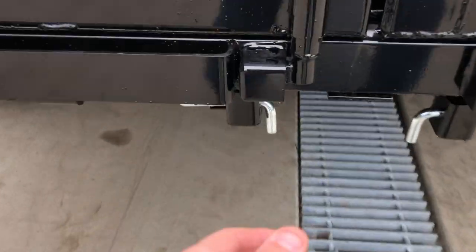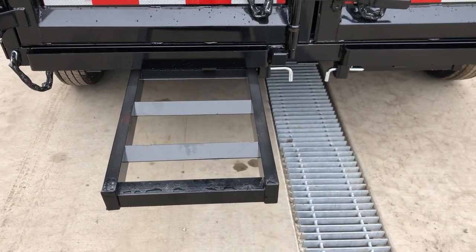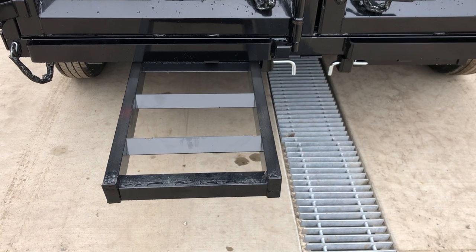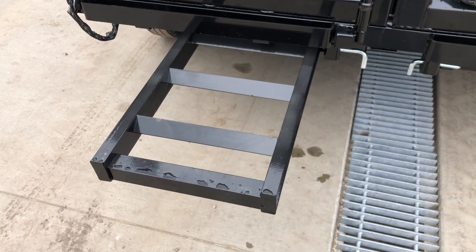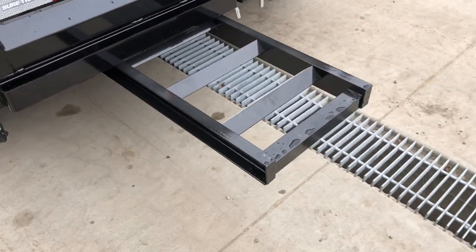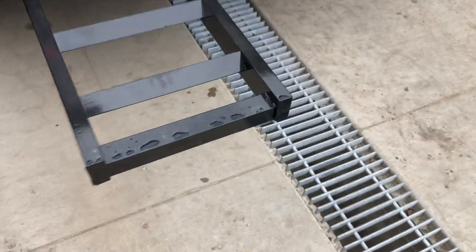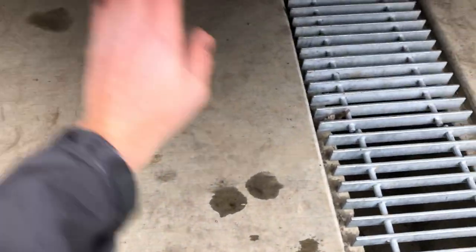This unit has about a 25 to 26-inch floor height with a 20-inch wall, so roughly 46 inches to the top of the wall. One nice thing about the bulkhead is it puts the lights up where the folks behind you can see them — less chance of someone paying attention to their phone and running into the rear end of your trailer. This unit also has a wider ramp, new for roughly last year — now about 18 inches. A lot in the industry are 15 to 16 inches, so you get an extra inch or two. Traditional 3-inch channel ramp with angular runners, and the back guide makes it very simple to push or pour where you need.